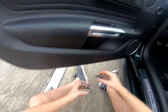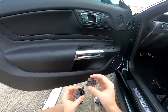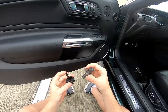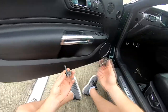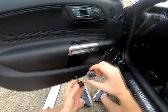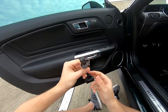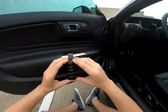For reassembly, my suggestion is to do it the same way you took it out — I did no damage to it. A lot of people say they break theirs but there's no reason for that, and no reason to spend $100 on a whole perch assembly from Steeda. Just spend $20-21 plus shipping for the spring. When installing, since this spring is lighter, put the bottom part in first, slide it in, compress by hand, then put in the top perch.